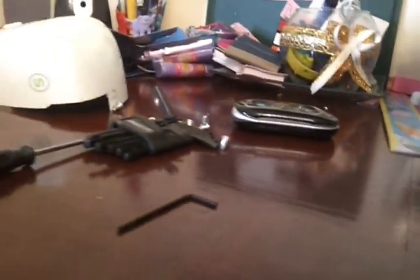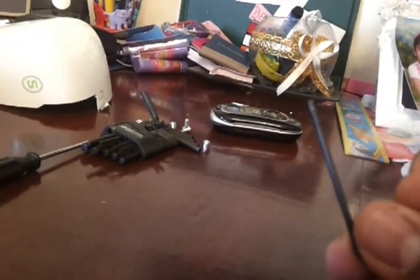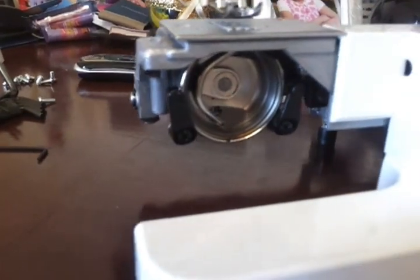There you have a shaft and it has two allen screws right over there. What you want to do is make sure the machine needle is at its highest point and that piece at the bottom — I don't know the terminology, the shuttle housing thingy majiggy — is at that mark. Then use an allen key, the size is 2.0, and torque those screws. If there is play, most likely there is play, line them up and torque them. That's what I did and it worked.